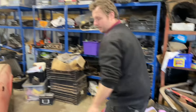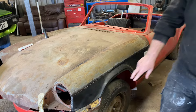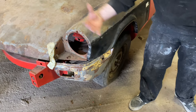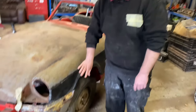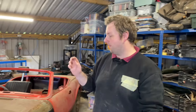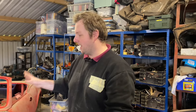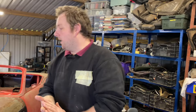So if we go over and look at the Spitfire — my daughter's little car. We've made a start on the bonnet and we've got the front wing on this side all back on. We'll do a small repair to what I think they call the D panel — it's a headlight panel under-structure support. We'll put some pictures on Facebook of the repairs as they come along. The other side needs a small repair to the wheel arch and possibly the D panel as well, hopefully not. Then we'll put the new front wing on that side, finish the body alignment, and then it's ready to be completely stripped body off the chassis — strip it back to bare metal, prep and paint it.